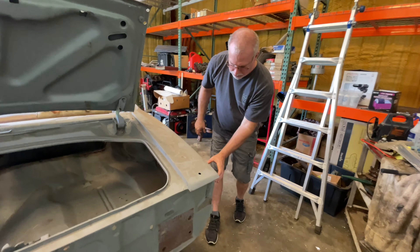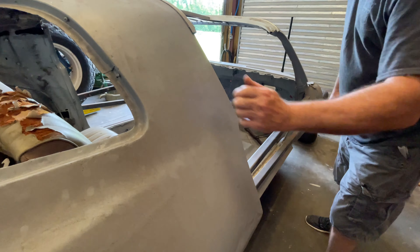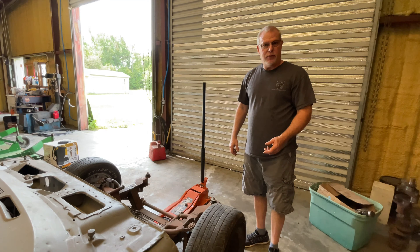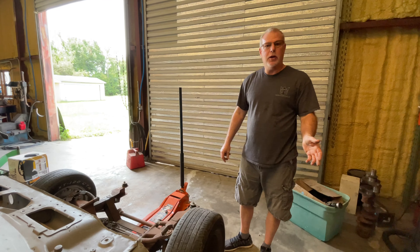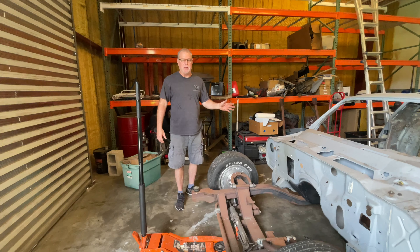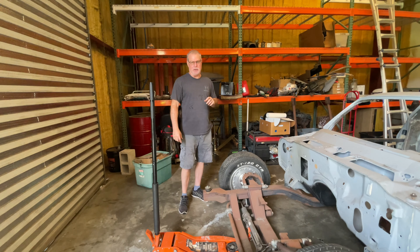The new piece comes down like this and then has metal back here with round tail lights that look really nice, and a nice chrome bumper. The quarter panel is basically all the same. The only pieces we have to replace: cut the quarter panel here and around like this — that section gets cut out and the new piece welded in. Up front, the doors are exactly the same, but the front nose is totally different. We're going to make the front nose a 1971 split bumper with single headlights, instead of that big ugly plastic 80s look — all gone.